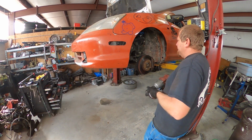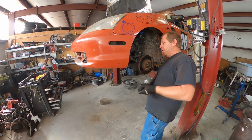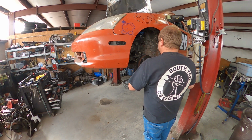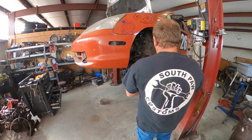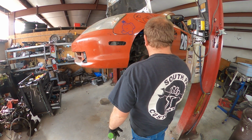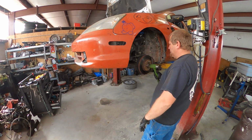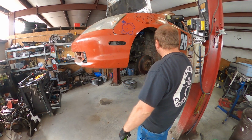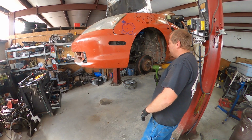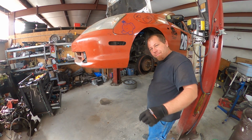Also, for those of you who are wondering, the axle nut is a 32 mil. So do yourself a favor. Okay, it's turning into an instructional video. Put the axle nut back on to kind of tap on it. Make sure the axle's loose. Do it while everything's bolted. It won't move far, but it'll break it loose. We had this one apart at NCM.